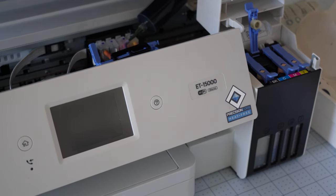Once it's empty, reconnect the tube and reinstall the little cartridge. Now fill up your tanks with your new ink. I didn't reassemble everything just yet — I'm going to make sure everything's connected and then refill my ink tank with the new ink. I'm refilling with inkjet ink from a different eco tank, so it didn't have the correct keyed bottles. I filled up my syringe using the needle tip and then filled up the tanks using the syringe. If you have the correct ink you can just place it onto the keyed holes and fill it up that way.